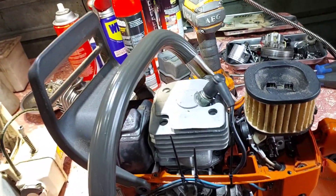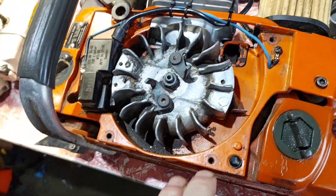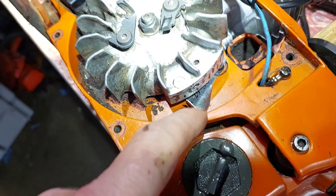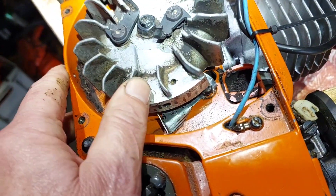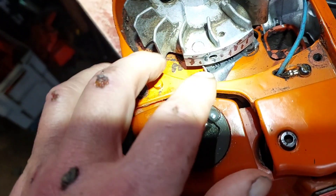Okay mate, Tyson's factory 372 Husqvarna. Now this is a big saw and I want to find out what the ignition timing on this is exactly. So I've got a stainless steel rule screwed on to where the air horn goes just there, and I've worked out timing marks on the wheel here.